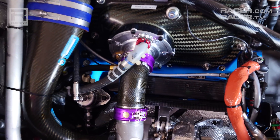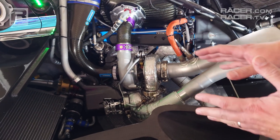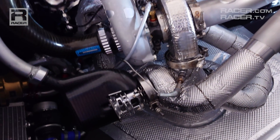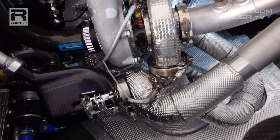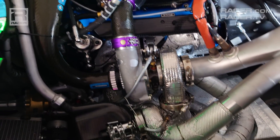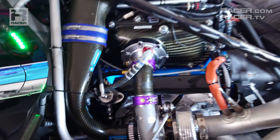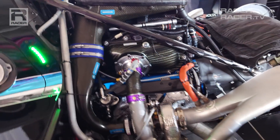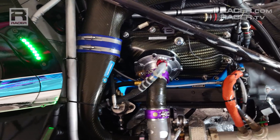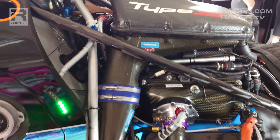What you can see there is a very compact engine. The turbo is very, very close to the head. You can see that we have a very large plenum, but we try to package everything around that. So you have an intercooler which is inside the plenum — and that's not really classic. You have an air-to-water intercooler, which is very unique as well.